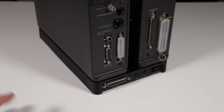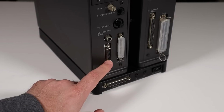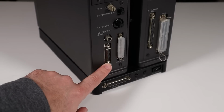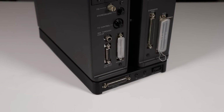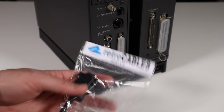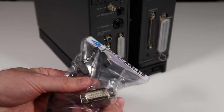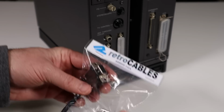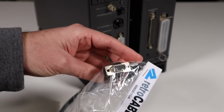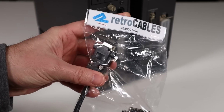Interesting. All right, it's well past time we got this thing hooked up and tried it out because I've been dying to get it connected since I've bought it more than a month ago. So the first challenge we have to deal with is the fact that it has a proprietary 15-pin RGB connector instead of a more traditional HD15 connector. So what I've done is I've bought an adapter cable from a company called Retro Cables, and I'll put a link in the description, and it just converts the X68000's 15-pin DB connector to a standard 15-pin HD connector. So we should be able to hook this up to any compatible VGA monitor.